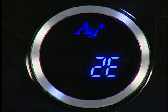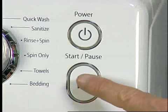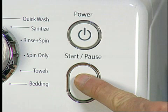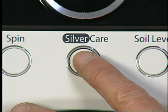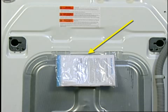While viewing any of the fault codes, push and hold the Start/Pause button to view the number of cycles back the fault code occurred. In this example, the fault occurred 15 cycles previously. These models will hold nine fault codes in memory. Dashes will appear in the display if there are no more codes. Press Silver Care to exit the diagnostic mode and return to the service test mode.